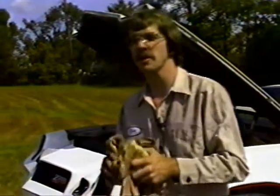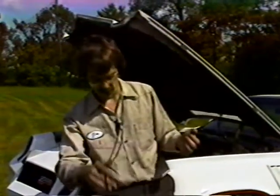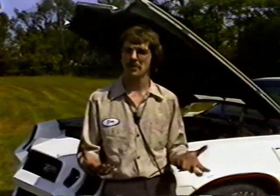Now that about covers everything. All I have to do is take the axle stands out and back the car down. It might be a good idea to park your car over a nice clean spot for about five minutes before you take it anywhere. If you've done something wrong — if you haven't tightened the oil nut tight enough or the filter wasn't on right — you'll know pretty soon because oil is going to leak out on the ground. After five or six minutes with no oil on the ground, you should be pretty safe to take off.